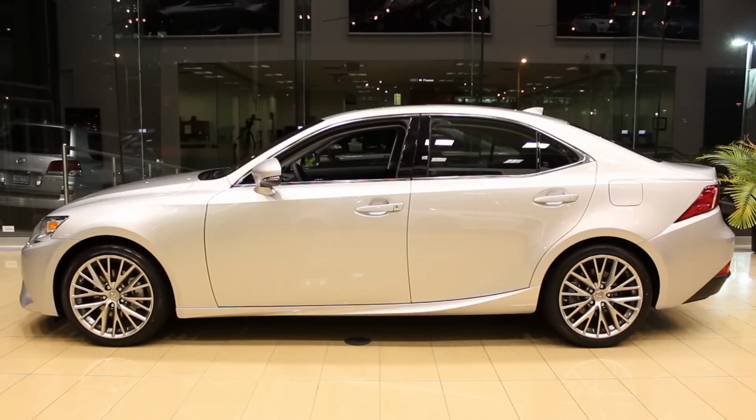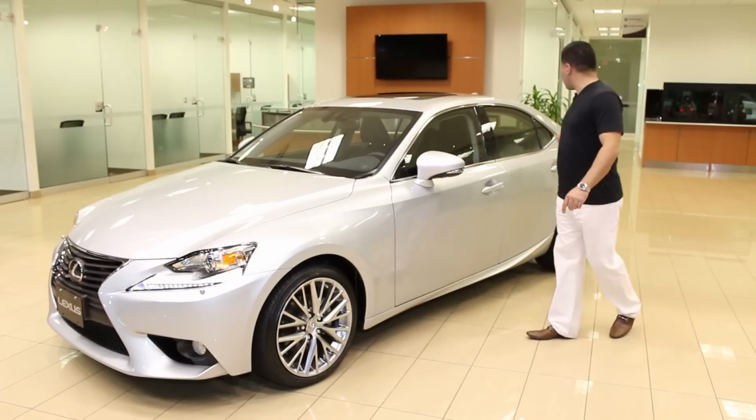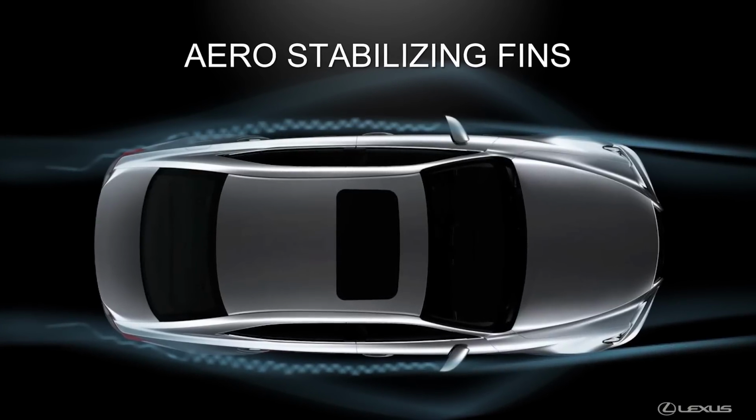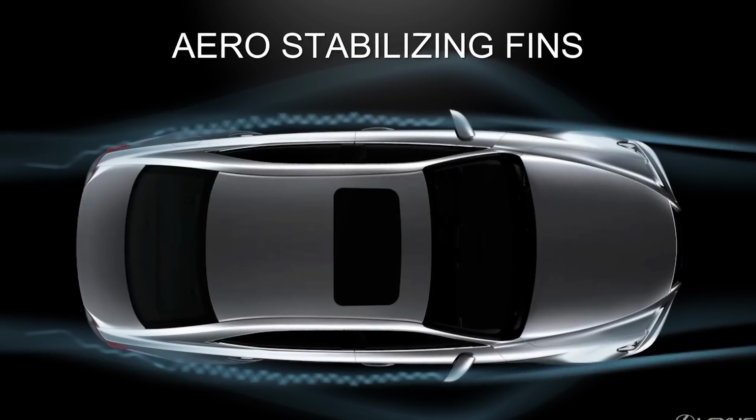It's kind of bow-shaped, so it gives it that sportier, almost F1 type body shape. And then there are these little aerofoils located just behind the mirror here in the A-pillar, and a couple more at the rear tail ends. One of the things they try to achieve with these aerofoils is to tighten the airflow on either side of the vehicle. As you're driving at higher speeds, vehicles can become unstable. The vortices these generate actually tighten the airflow on either side of the vehicle to keep it more stable, which gives it a better, more fun to drive experience.